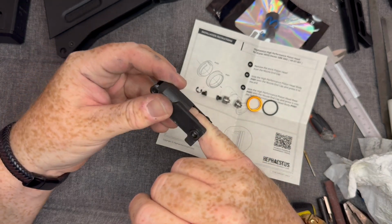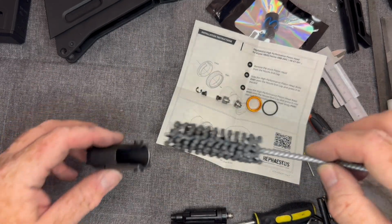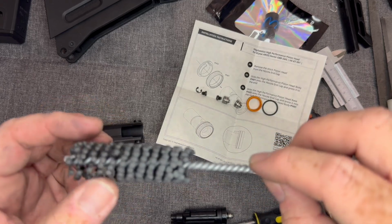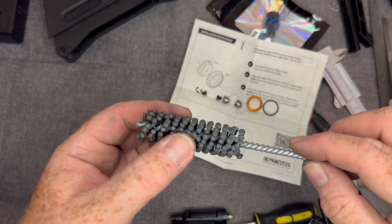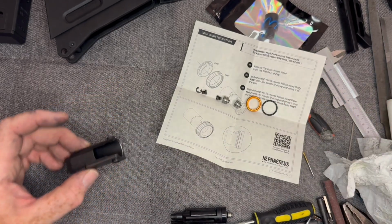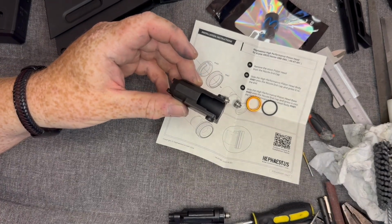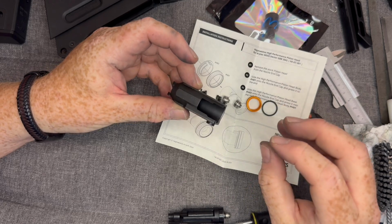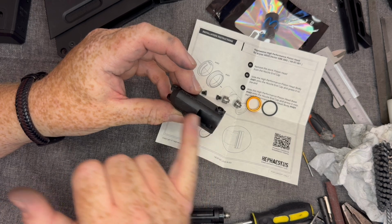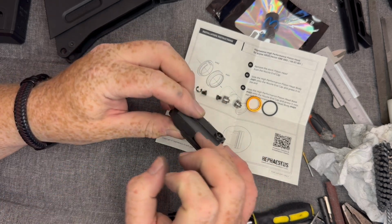The honing that I do, I'll show you what I use, but basically it's this thing. It's probably a bit large for this, but I think it will work. And basically what it's got on the end here are lots of little sort of grit stones, and you can hone the inside. The idea of honing is that you could mirror polish inside and it would probably give you a good seal, but they hone the inside of engines because it enables good lubrication. So it means that it can give a good seal, but also allow oil to travel up and down the honing marks inside. So I found good results with honing.